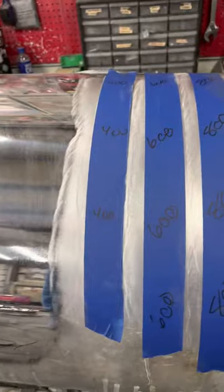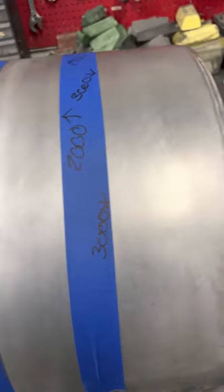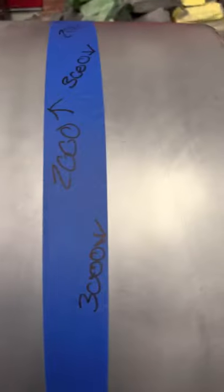All we got left is 3,000. Let me spin you around so you can see it one more time - 400, 600, 800, 1,000, 1,200, 1,500, 2,000, and then this side over here is gonna be 3,000. Right now you can see it's super smooth but there's no reflection at all. The 600 and 800 section here has some reflection, but over here we're losing the reflection - super smooth but the reflection is gone, which tells me the pores are closing up. Not always a good thing when sanding and buffing.